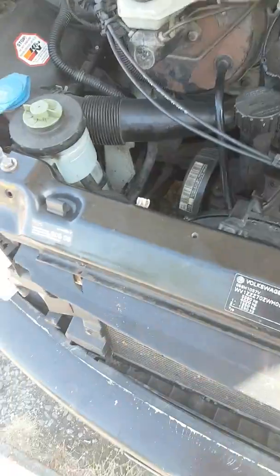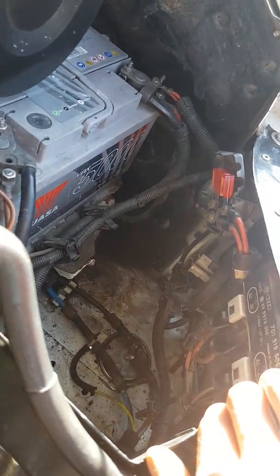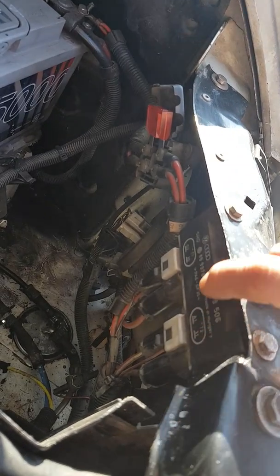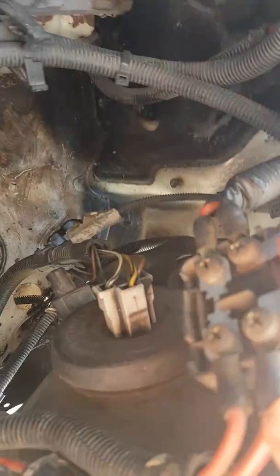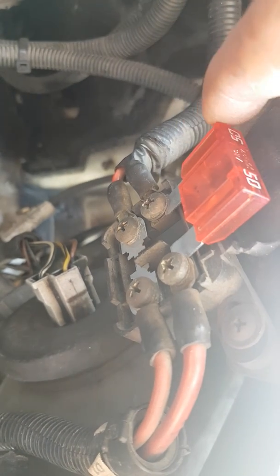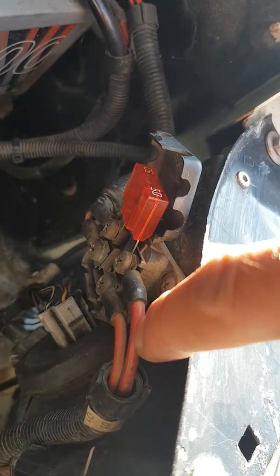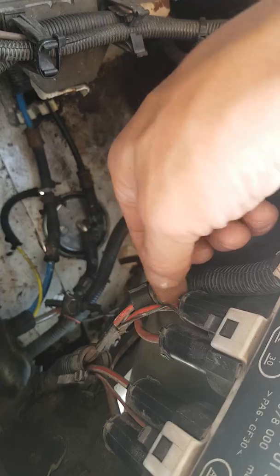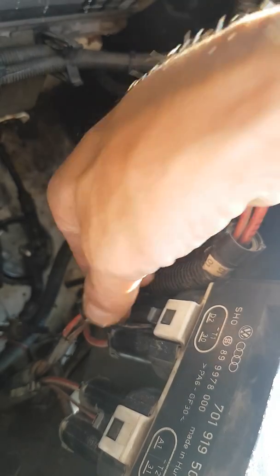After checking online, I found out there's a fuse pack right here next to the ECU — the main control unit for the fans — with a fuse which is normally a flat fuse. I've had to interlink it for emergency reasons using a 50 amp blade fuse. This is a direct line from the battery to the fuses and down to the ECU.